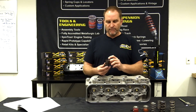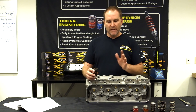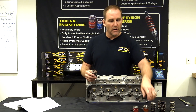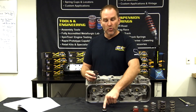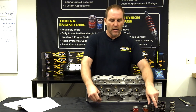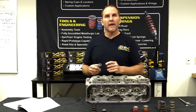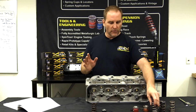We're going to use our 1325 — old reliable dual, no damper. This will be the spring actually going on this set of heads. There are a lot of things to look at when considering springs — what kind of retainer you're going to use. We have our standard chromoly, two different grades of titanium, and tool steel. Tool steel is the hardest, it's expensive, and it won't wear. It's strongly recommended when you're running a valve spring with a damper. The damper is a very thin wire — it's like a little beaver chewing on that retainer. It will eat through titanium retainers, and then you have titanium in your engine and eventually a failure.